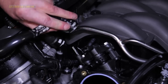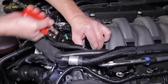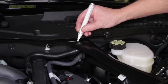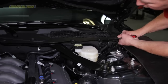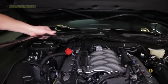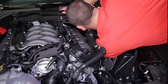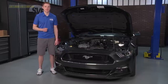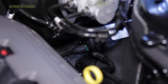Disconnect the passenger side PCV from the factory intake manifold. Disconnect the throttle body connector by pulling back on the red tab and pressing the black release tab. Unlock the green connector and disconnect the evaporative emission canister purge valve (EECPV). Mark a cut line on the left hand side of the K-brace using the wiper cowl as a guide. Remove the six push pins on the cowl trim panel and lift up to remove the two nuts and five bolts holding the K-brace. Slide the K-brace out and remove it from the vehicle. Remove the sound tube by prying up the push pin on the strut tower and removing the 10mm nut on the firewall. Remove the two nuts securing the brake boost vacuum hose and heater hose support bracket to the intake manifold. Disconnect the brake boost vacuum hose from the port at the firewall and remove it from the car — set it aside since it will be modified later.